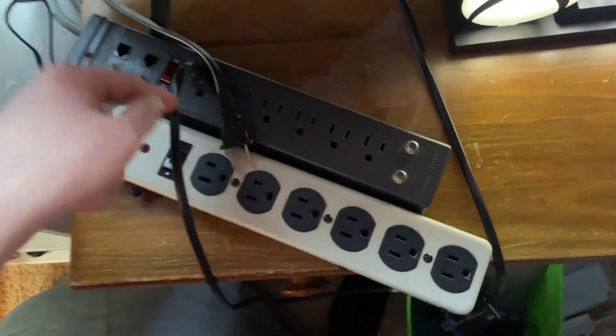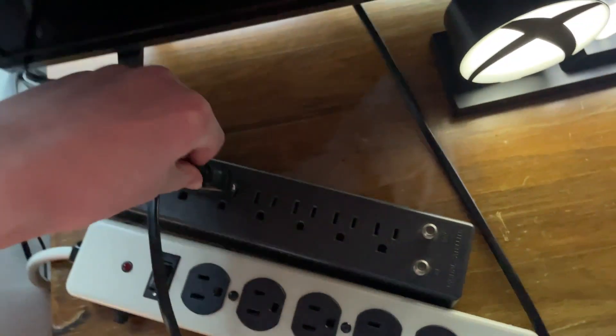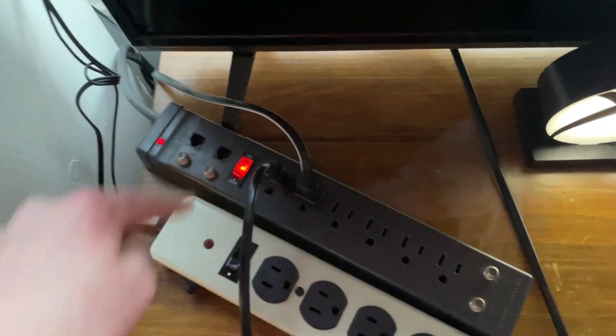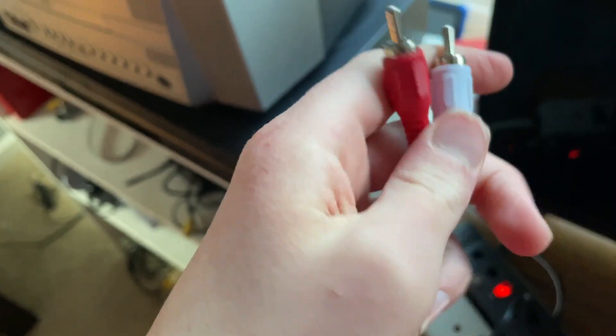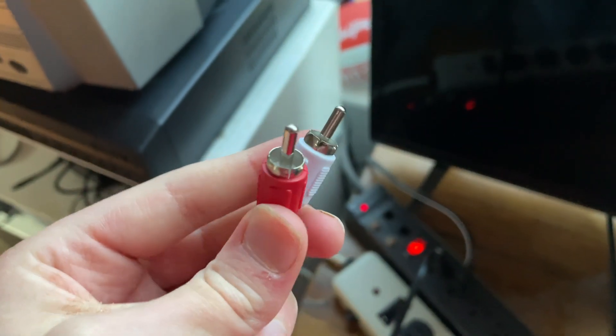You're going to want to have your monitor plugged in and plug the VCR in and power. You should get some signal. There are actually two different methods to this. I will show you both, but for both you're going to need a male-to-male RCA set of cables, which are really cheap to find online if you don't have any. Let's go ahead with the first option.